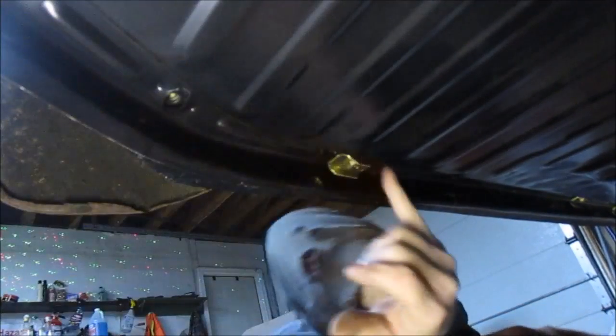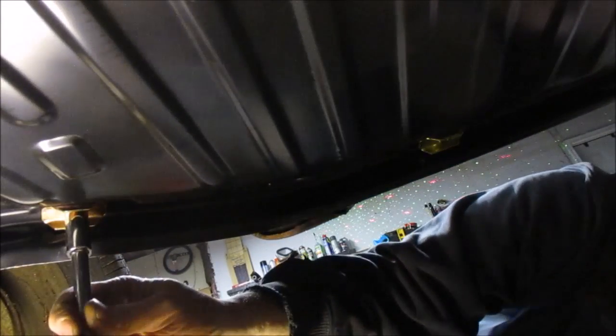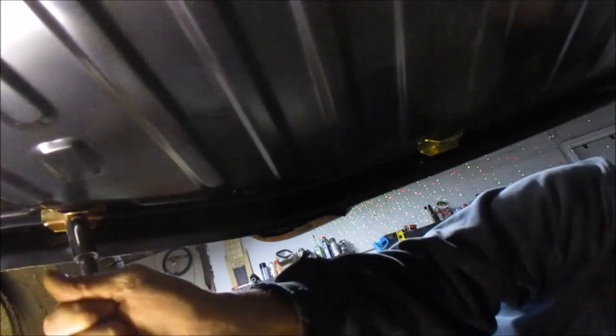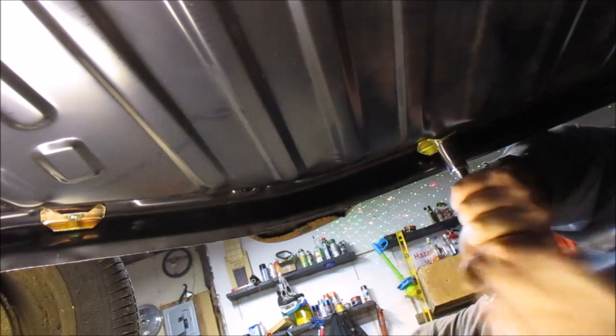All right, so hopefully you guys can see that we got some bolts into the pan and heater channel. So that's pretty close to being lined up — that's a big win for us. This will help keep everything lined up while we do the final fitment of the pan. It looks like that quarter inch we took off the back was exactly what we needed. We're just going to snug these down a little bit so that the placement of the pan and the heater channel stay in place.